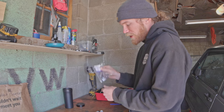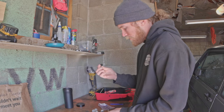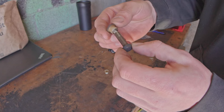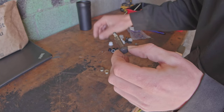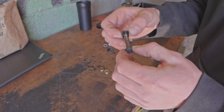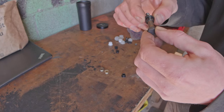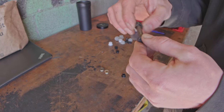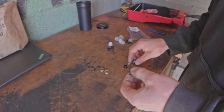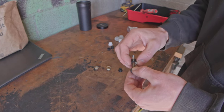In terms of these bushings, this is actually a complete kit — assuming you didn't have the weird Heim joint linkage that I have, you could replace most of your bushings in your Volkswagen with this kit. So there's our old bushing — kind of wobbly. That was probably the better one; this might be the worst one. Yeah, you can see that — that's not good. And these are our new bushings — they're just as loose at first, but just kidding, that one's great. You can see we do have quite a bit of improvement; it's not perfect by any means, but these are our new bushings. They are still better than the old ones — that's a lot of play, and this is just a little bit of play.